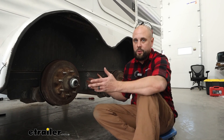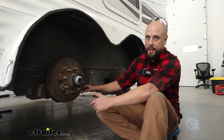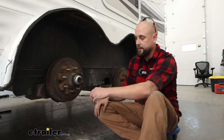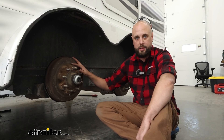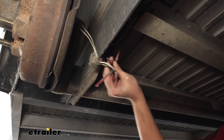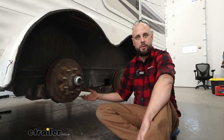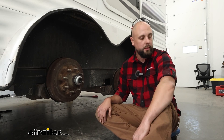To begin, we're going to have the entire vehicle off the ground, allowing our axles to just hang freely. You can do this with the tires and wheels on, but we're taking them off to make it a little easier for video purposes. We need enough room to drop down the axle and place the spacer in between the frame and the axle block. Also take a look at your wires or hydraulic lines going to your brake system — if you've got electric brakes or drum brakes, make sure those wires are going to be long enough to accommodate for any travel after the spacers are installed. If you need to extend those, grab some butt connectors, strip back those ends and extend them. Luckily for us, we've got more than enough underneath the trailer to work with.